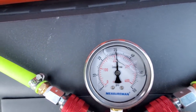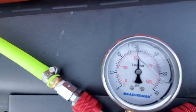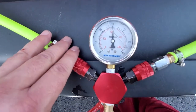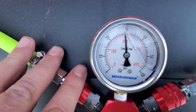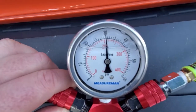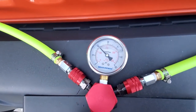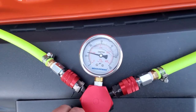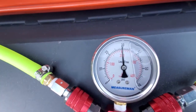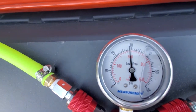As you can see, I've got 31 — 30 and a half pounds. It's totally equalized. So to lose my pressure, I'll get it to 30. It does have a little bounce-back; it will go back to normal, so you'll have to let the air out and then shut the valve off and let it equalize again. So I'm at 30... now I'm right at 29, 29 and a half... there we go — 29 on the dot.